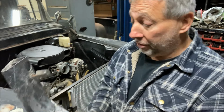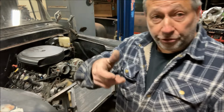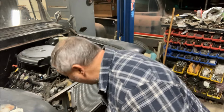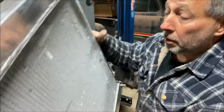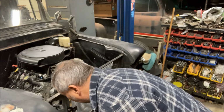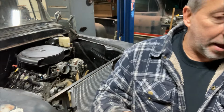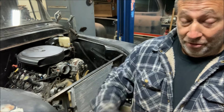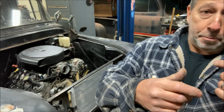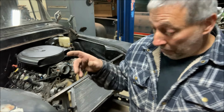So what I ended up having to do was kind of like spot welding. I had to just zap and try not to overheat it, and then come back and grind the snot out of it so it didn't look horrible. But it was not easy doing that, because the other thing is you get burn back. Aluminum wire burns back much easier than steel wire. I went through 3 MIG tips to do that, because 2 times it burned back, and once it burned into the tip, the tip's junk. You could not free it up. It just didn't work. So definitely a learning experience.